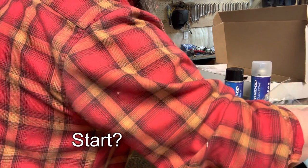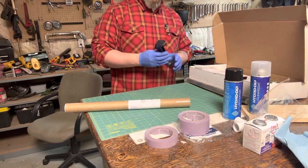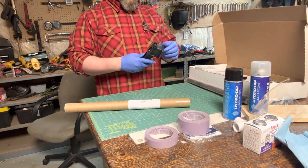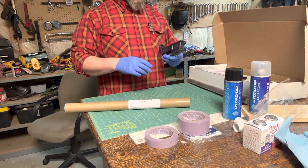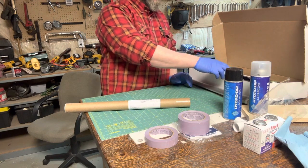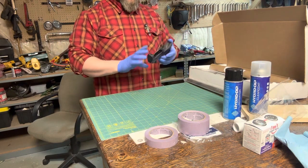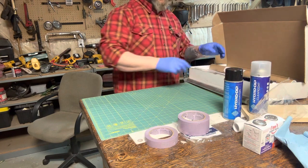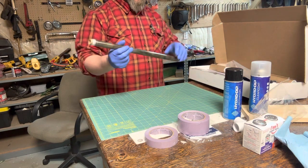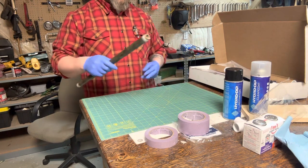Okay, to start, we're going to focus on SDI film with this lower. And you see I'm wearing a fresh set of gloves again. Full disclosure, after I washed them, I went downstairs and started to tape them. Realized you still have to have their base coat before you tape. So there we are, back out here again. And I already wiped them back down with acetone, so we're back to clean again. So what we're going to do first is measure out our film and ensure that we have the right size so that after we spray, we're ready to dip.